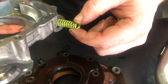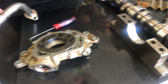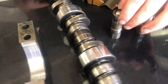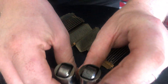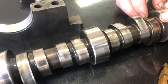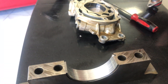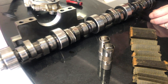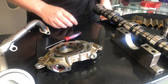There are different springs available to give you the desired oil pressure. The reason we're showing all this is because customers come in with a blown up motor, which on the surface could have been very easily diagnosed as just a lifter failure — it's chewed out the cam, chewed out a couple of lifters — but the root cause of a lot of the damage is this oil pump. Had we just done a cam upgrade or put a new cam in with new lifters and started it up, it would have easily just destroyed all the brand new parts because of that oil pump being the root cause.